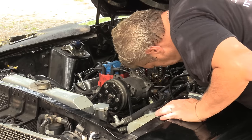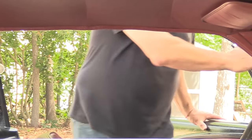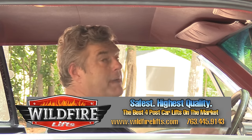The plug wires are reattached and we're ready to go. Every time you make a change, always start the engine up and see what's happened — it gives you a chance to know if you've made any progress. We started it up, and we've got a little bit of a miss, but we don't know what the timing is yet. It starts right up and it runs, but we've got that stumble on acceleration. That stumble is typically an accelerator pump issue — we'll check that out.